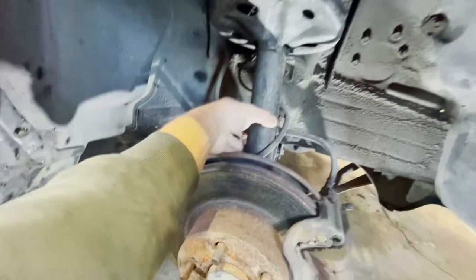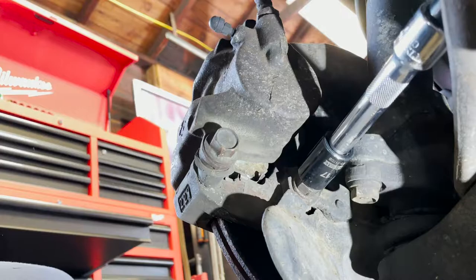You're going to wind up taking out this whole knuckle with the rotor and this whole spring assembly. Then drop these three nuts on top and it should come right out. There's also a sensor with a bolt on the back side of the dust shield you'll want to take off as well. I'm also possibly going to be removing my dust shields — you'll see in the video.